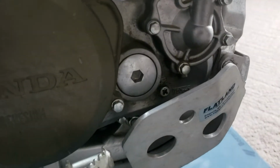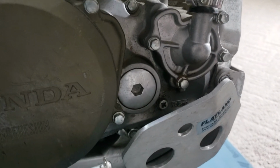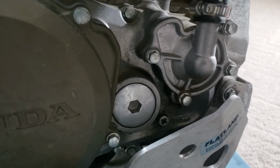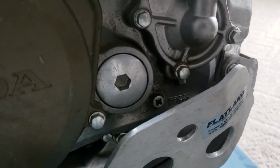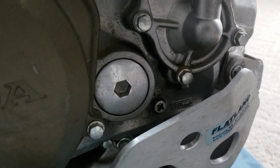Okay. Pull that little bolt out of there. That's kind of your pisser bolt. Kind of like on a leg of an outboard boat motor. When you do the leg oil in it, it's got that hole. When it starts peeing out of that hole, you know you're full. Okay, as soon as it just barely starts trickling out of there, put that little bolt back in.